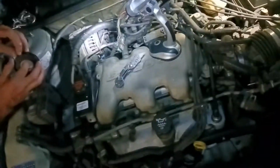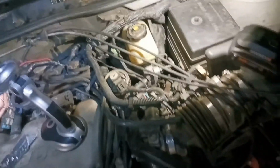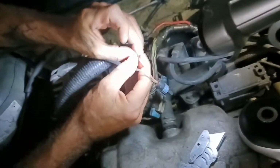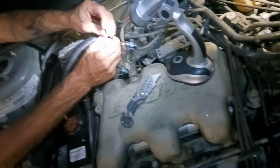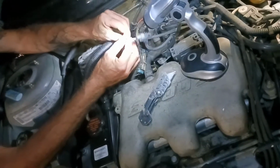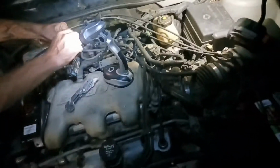And if it's still sluggish and misfiring, then I'm going to go ahead and swap out this crank sensor and this whole wire, and it just plugs in on the ICM right here and just runs down underneath that crossover and rear manifold, and it's just one 10 millimeter bolt. So hopefully this was the issue. And whenever I cut off that plug there, Tommy stripped back the wire and it was all green and corroded. So that was probably the issue. So I cut it off further down and stripped it, and it was nice clean copper wire. So stripped that plug and we're getting it hooked up, and hopefully that fixes the issue. So y'all give us just a few and I'll give you guys another update.